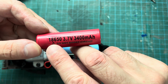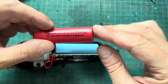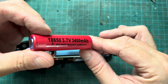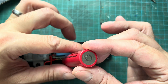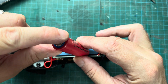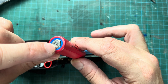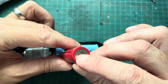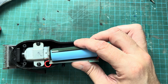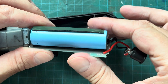There's no label on this original battery, so there's no '18650' written on there, but size-wise it's exactly the same. We're assuming this is the correct battery because it's a really popular battery type. We just have to make sure we use the positive and negative poles in the same way — we don't want to accidentally install the new battery in the wrong direction. So make sure before we remove the original battery that we find out which direction it's installed.